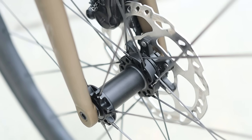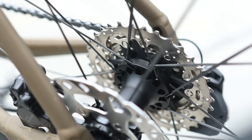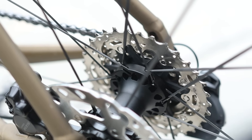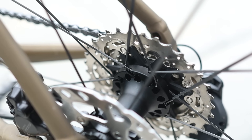If I have any gripes with these wheels, it would probably just be the straight-pull hub design with no safety measure for spoke retention. It was Peak Torque who did a video on this, and I have to agree — if one or two spokes fail, the other spokes can easily lose tension, and without spoke tension there's nothing preventing the remaining spokes from falling out of the hub, which could be disastrous and totally avoidable with a little threaded plastic disc serving as a retention plate. Nonetheless, lots of wheels feature this simple straight-pull design, but it does sometimes make me a little bit uncomfortable.